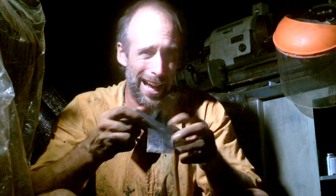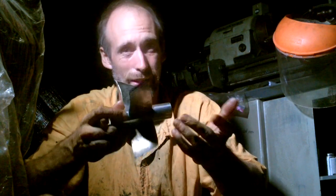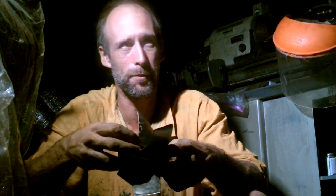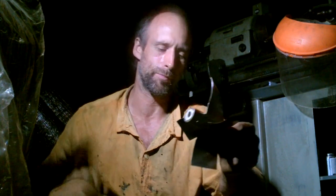On this propeller, I actually did some calculating. First I figured out how many times per second this rotates. RPMs isn't as useful because minutes isn't useful for anything. So revolutions per second — roughly six. That's a decent pace. Now, the speed I want to have the boat going is like 12 miles per hour, 20 kilometers per hour. That may be hoping for a lot, but I'm hoping I can do that with the motor and pedaling at the same time. So I'm designing my propeller for that.